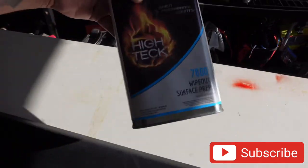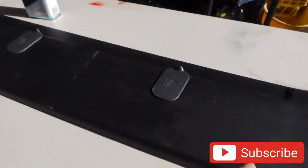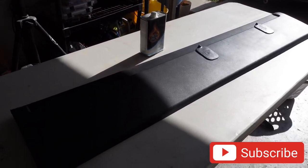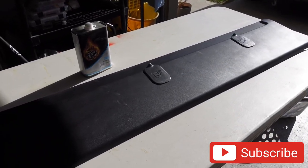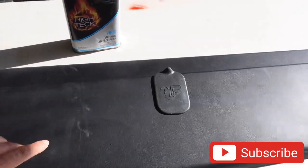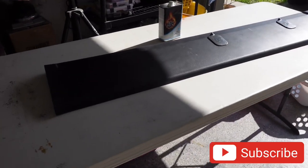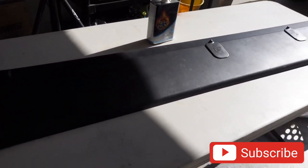Before we get started, I'm gonna go ahead and clean it with the high-tech prep to clean off all the oils, and then we're gonna run the DA with a nice 80-grit and scuff it up really nice to try to eliminate some of the texture. The reason we're going to scuff it up with the DA and 80-grit sandpaper is so that when we go to set our rings with the hot glue gun, we want it to bond really good and not fall off. This plastic is a lot less brittle than OBS trucks, so we can definitely run the staple gun through it.